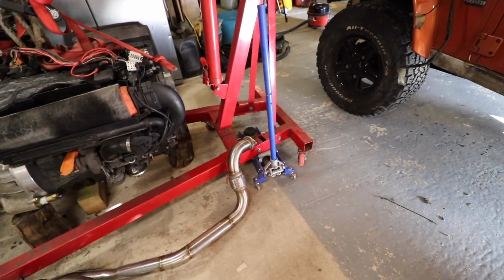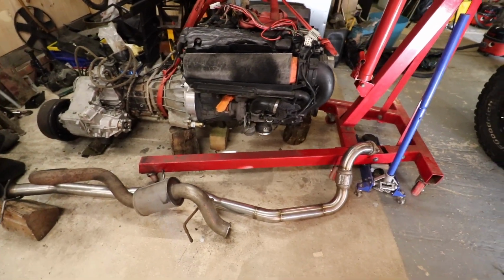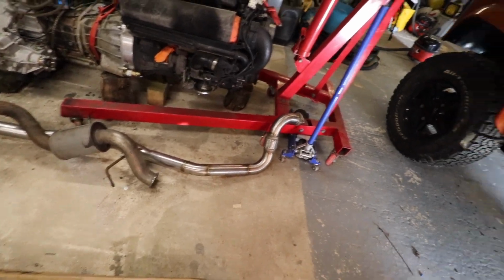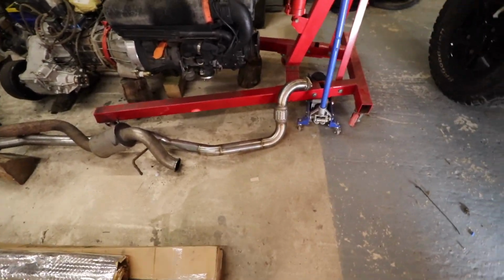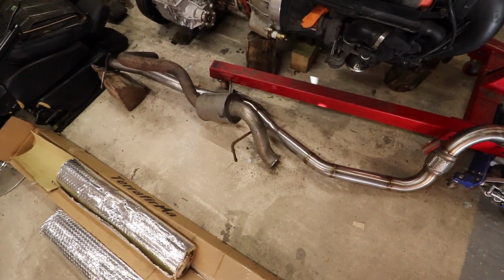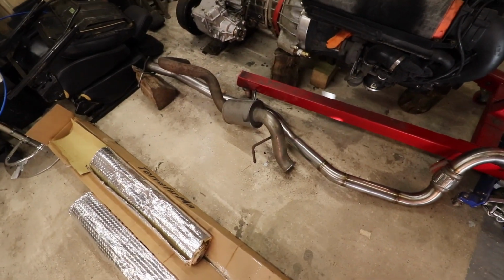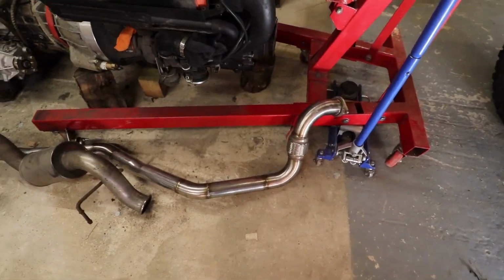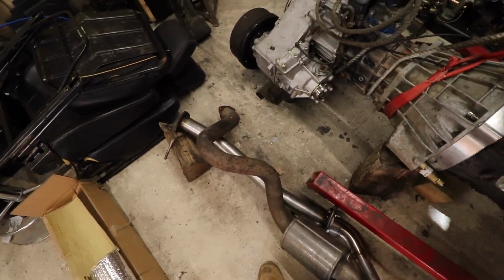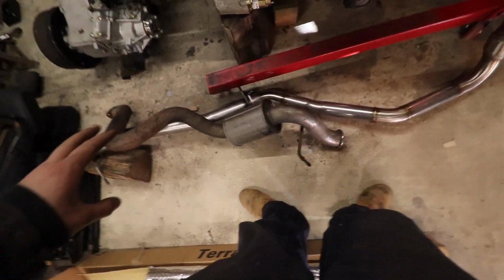We only had to modify the seat tunnel where the cover goes over the gearbox ever so slightly, and other than that, nothing else has had to be chopped away, and that's easily fixable. The exhaust system, as you can see, when the engine was in the car, we slung it up underneath the car, and actually, miraculously somehow, with Marcus Williams from NW Machines' adapter front adapter, it fits perfectly using a TD5 90 centre box and silencer rear section.